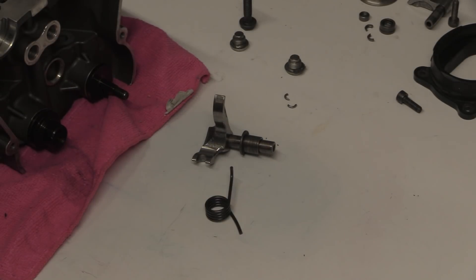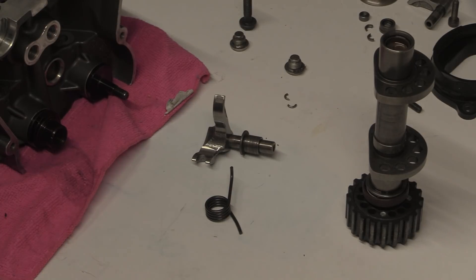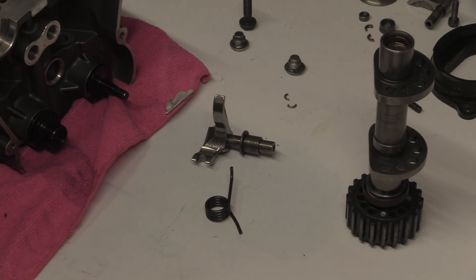So why is there a spring in this system and what is the Desmodromic system all about, what was it for? Back in the day what used to happen is that your conventional compression springs — generally on the exhaust side because it was hotter and suffered from higher thermal expansion — the regular compression springs that are in that head over there would fail and they'd either crack, stuff like that.